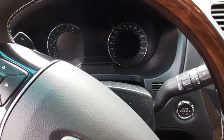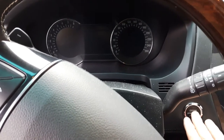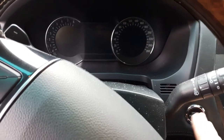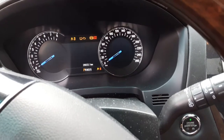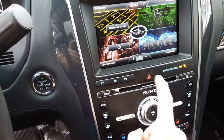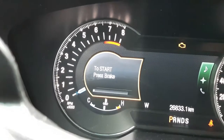There are two methods — one involves pressing a button a few times, but I'm going to show you the simpler one. Without the brake depressed, you turn on accessory mode, then press and release this button three times. You'll hear a honk and then see a message that says 'Train'.